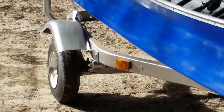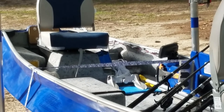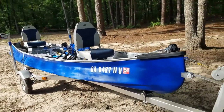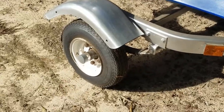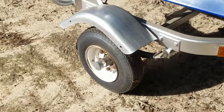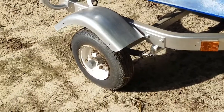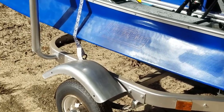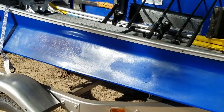As you can see right here, this amber light on the trailer, and back here the tail lights and brake lights — that was only about 23 or 24 dollars for that kit and it had everything I needed in it. Got it wired up and got it painted, and the trailer's in good condition. I put brand new tires on it. I put these grease hubs on the axle to the hub there, and that way you fill those up with grease and it's real easy to grease them — it won't go dry on you and burn up the bearings. Those two cost about 24 dollars, and the wiring kit was about 24 dollars.